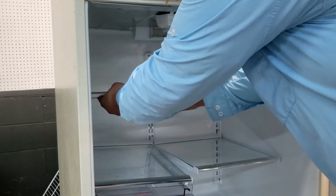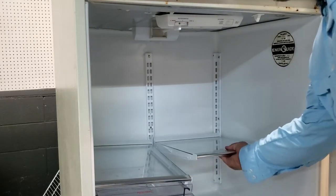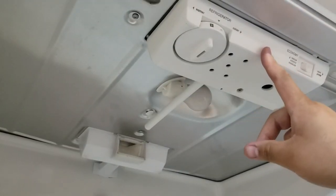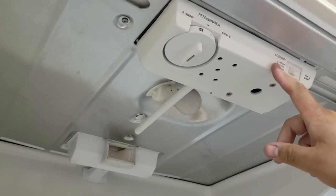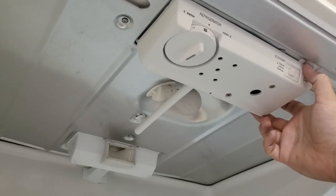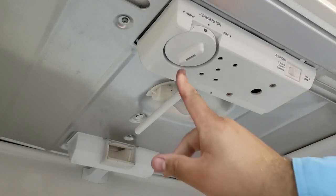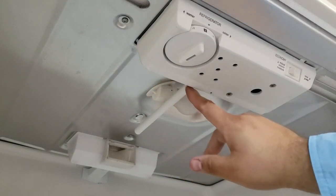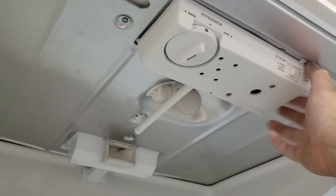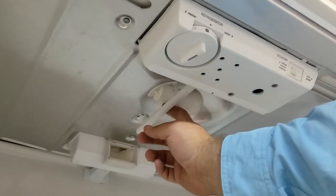To get started we need to remove some shelves so we can begin work on modifying the thermostat and defroster system. Most upright deep freezers have wire shelves, but since there's no room to hold them on the sides of the refrigerator liner we'll have to save these same shelves for later. This is called the cold control or cold thermostat. The idea is to take this housing apart and install a deep freeze thermostat instead of a standard refrigerator thermostat.